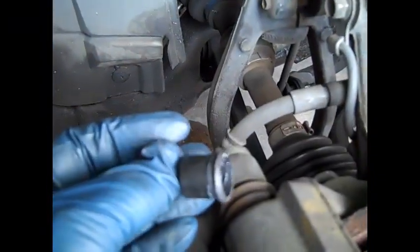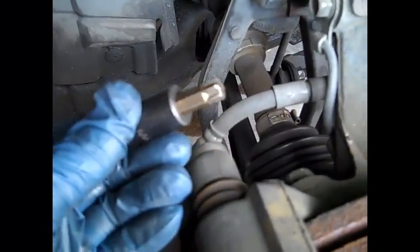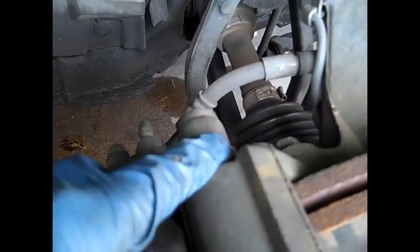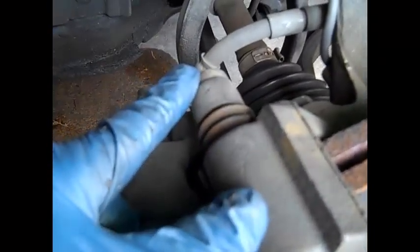You pull this little cap off — it keeps stuff from getting into the Torx bolt. On this year it takes a T50 Torx bit. And it's only one bolt on the caliper — it's the bottom one — where a lot of calipers have two bolts. The Mazda brake design has one actual bolt pin and it slides on the other pin, so you pull it off and slide it out.